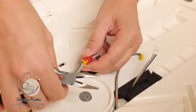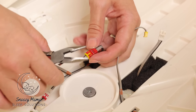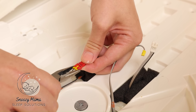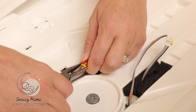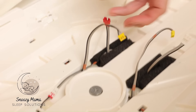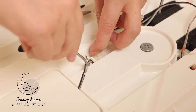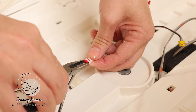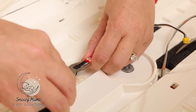These are a little stiff. If you have a newer Snoo — this is a 2019 — you might be able to just pull with your fingers. But for older Snoos, 2020 and below, you're going to need a tool. Hold onto the bracket and slowly wiggle it free. You're going to do that three times — one, two, three. Remember, do not hold the wiring; hold the bracket — because if the wires come out we can't get them back in.